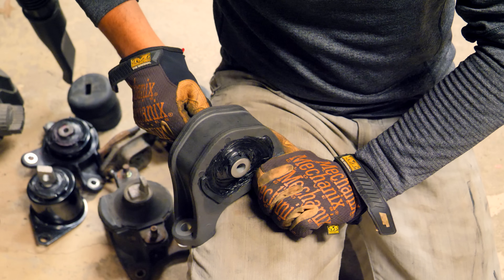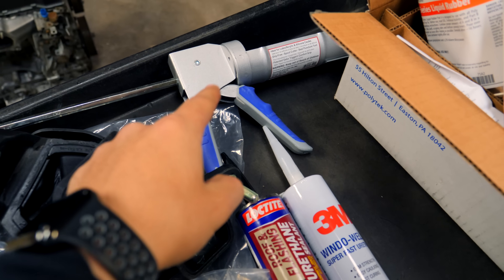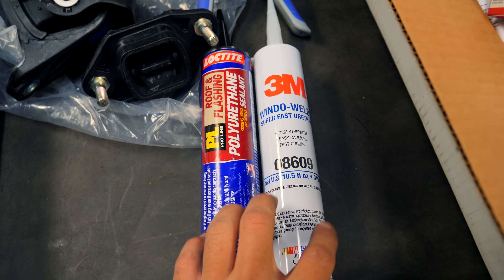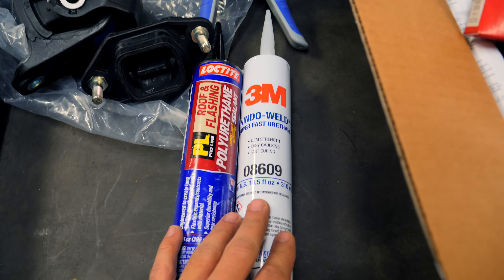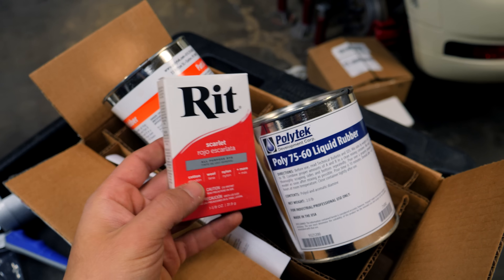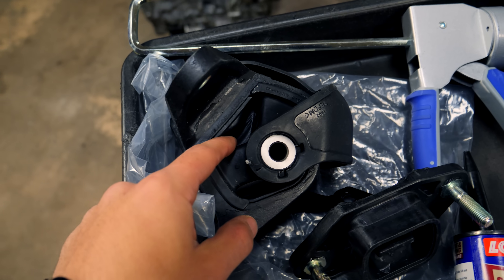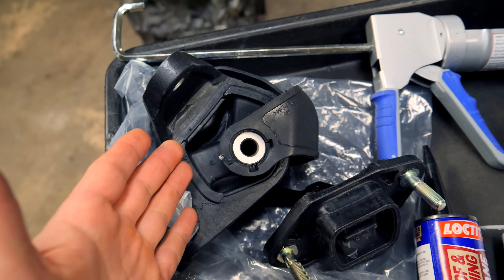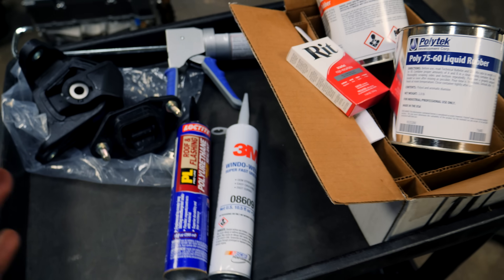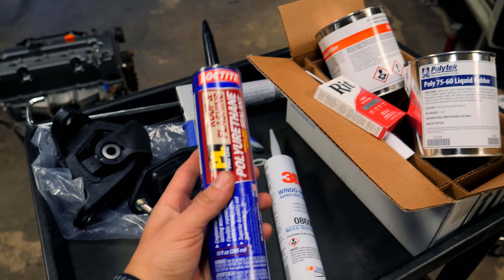To change out the stiffness of each of the bushings, there are a couple different options. We're going to be using one of two products today, both of which need to be used in conjunction with a caulking gun — you squeeze the product out and fill up each of the cavities. If you want a softer polyurethane, use this product from Loctite. If you want something stiffer, similar to a race mount, use this product from 3M. You can also make your own polyurethane, dye it any color, mix it together as a two-part product, and pour it into the cavities — or remove the entire innards of the mount and completely fill it. That route can be messy and usually doesn't look great since we don't have molds on the consumer end. So we're going with the more DIY route using these products, which you can find in the description box.